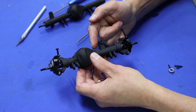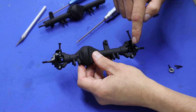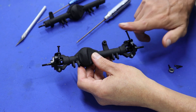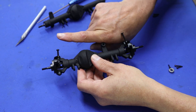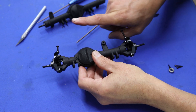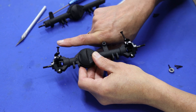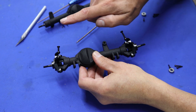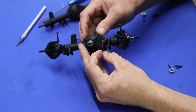The front is done now. This side will have the tie bar that goes across, and the other side will have the tie bar in the center and the steering push rod above it. It matches the same angle as the track bar, so the track bar mount and the steering mount are in parallel — the track bar goes that way and the steering bar goes that way. And there we have it — there's the front axle build.